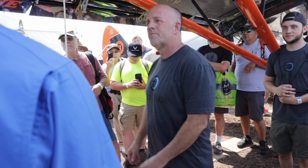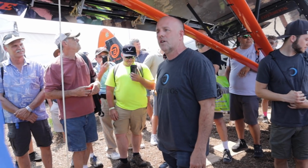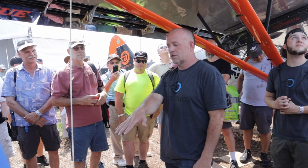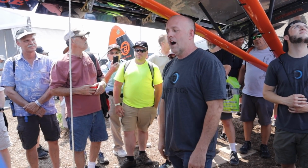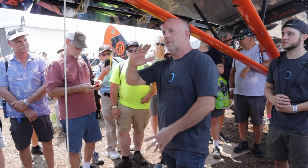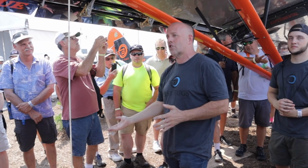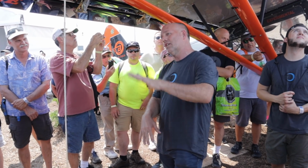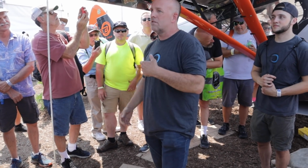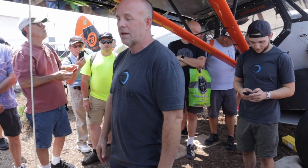So far, so good. Does visibility stay the same when you're doing your climbs? On my approach to land, my visibility is better than any of my Cubs I've ever built or flown in the past. It's right over the nose. I haven't taken it to the phase where I go extreme and hang it and see how much slower I can get on the back side of the power curve. So far I'm in the low 30s coming in flat, idle back. I'm not having to power it to hold it, and it just floats. So far I'm happy. We'll see where it goes.